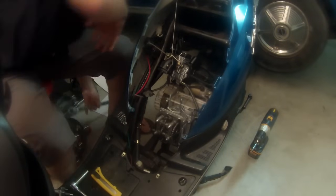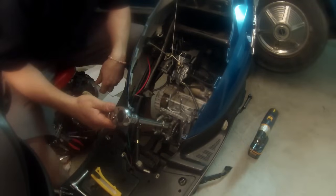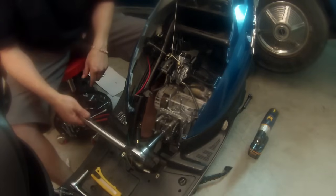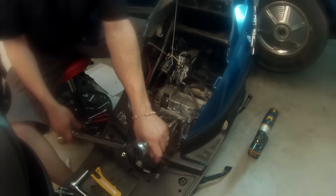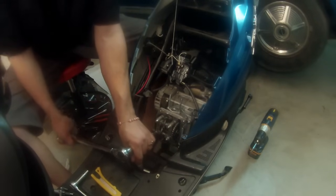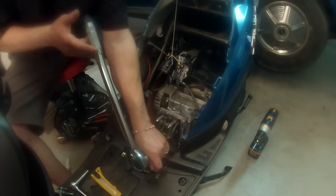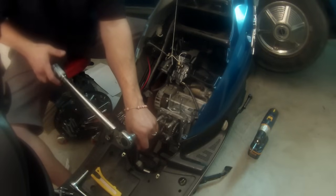All right, guys, I'm bringing you back up here so you can see. This manufacturer recommends that this bore kit is at 13 foot-pound torque. So that's every one I've seen so far, but I recommend doing your research. I always see them at 13. But I'm gonna do it in small increments. And I always take my time because this is not really something you want to over torque or under torque.